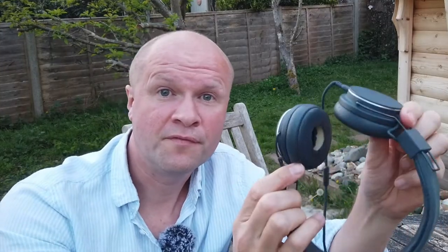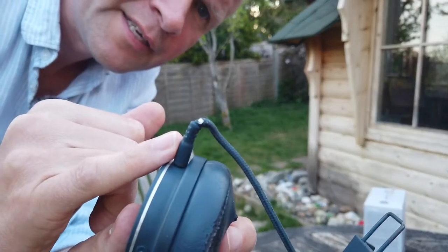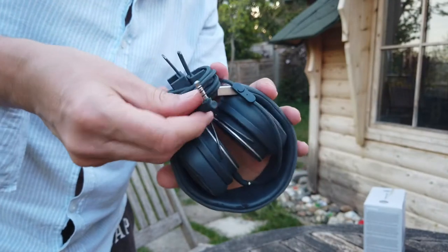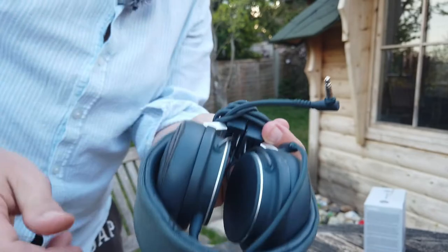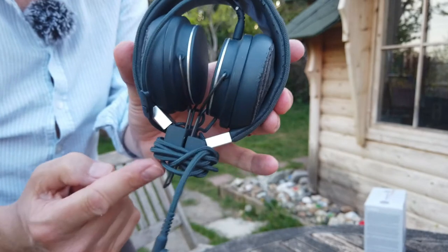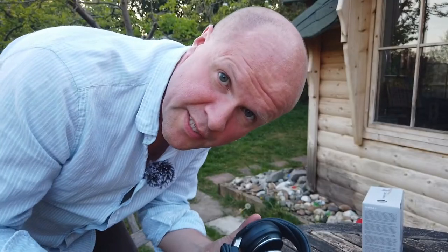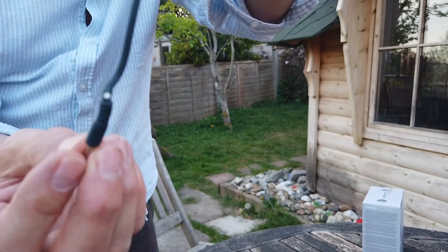The last element is the cord and if you can see it's slightly frayed. That is completely my fault because they're designed to be wound up, and then you can tuck the 3.5mm jack under the cable and throw it in your bag. What happens is, because I haven't extended the cups, the cable clashes against the headband and bends it, and over two years of daily use it has caused the cable to bend slightly and wear away.